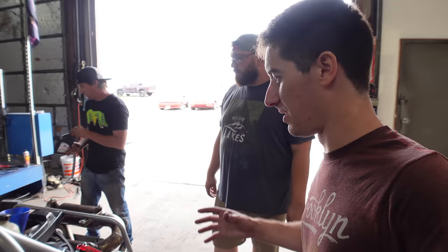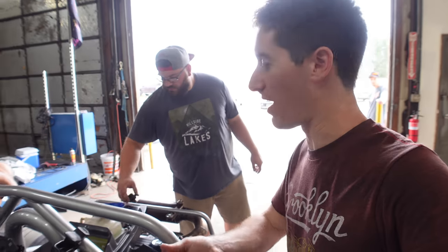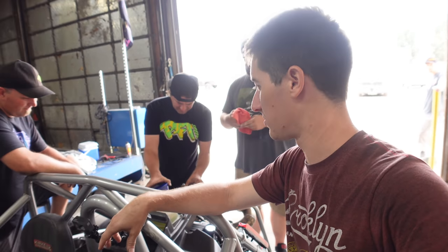With the new fuel pump, it was trying to clamp down on the injectors, we think. It was running just fine. AFR was like 14.2 while we were just chilling. But it was trying to bog because of drivability issues with that huge pump and those exact same injectors.